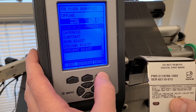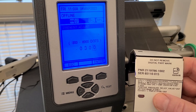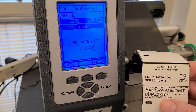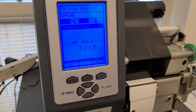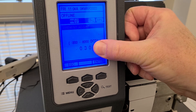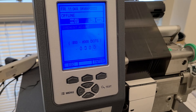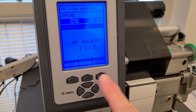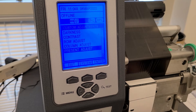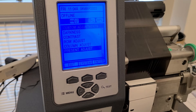Present Adjust is a static value — I find it works best if you just keep it at minus 300. And that's pretty much it for positioning: top, bottom, left, right. Make sure Present Adjust is always a static value of minus 300. Note: if you're doing this from the web page, there's a bug where you can't enter minus 300 directly. If you enter minus 030 from the web page, it will probably come through correctly as minus 300 — but you'd have to check.